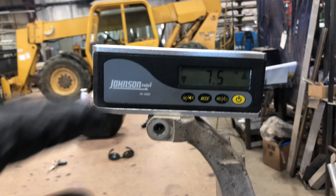So it'll be 0.5 when I cut it. This right here is at about 90 degrees, so after I cut it I have to make sure that's back at 90, because that'll keep this piece correct. I got that also to 90, or 0.3 — it kind of messes around a little bit. I've got this piece of metal in there, it's flat, those are all against the ground, and I measured that — it's at 90 degrees.